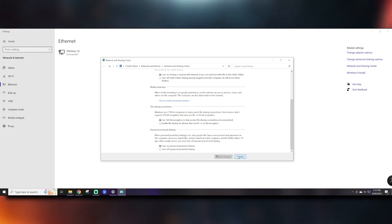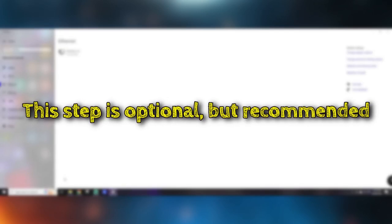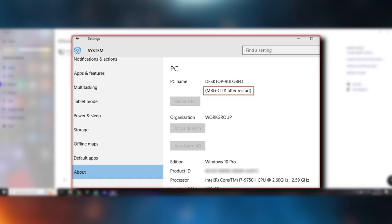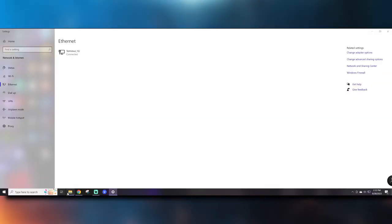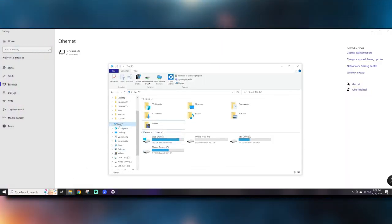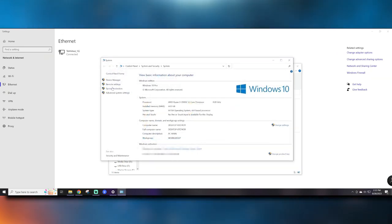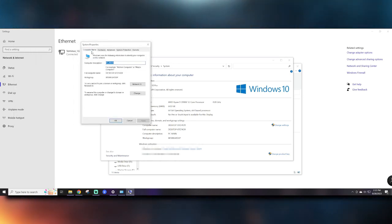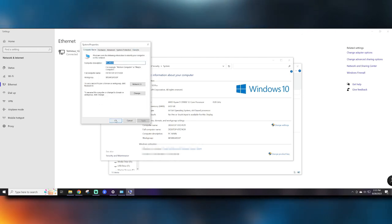And since I've already set this up, I don't have to save, but make sure you do. The next step is optional, but makes recognizing your devices easier, especially since default PC names can be a bit long and all the more confusing should you have multiple devices on the network. Open your file explorer, click This PC, then move over to the open space and right-click to access the properties. From there, click on advanced system settings and select the computer name tab where you can change your PC's name. I've already gone ahead and changed mine. Make sure to do this for all PCs you want to share files between.